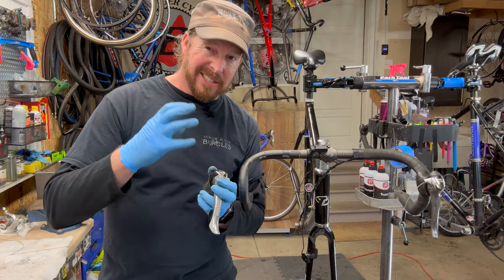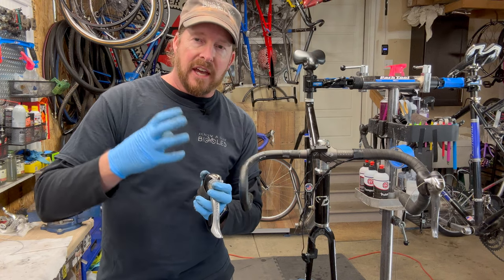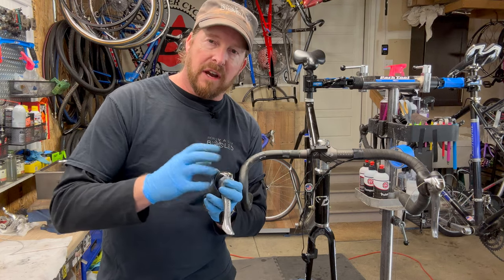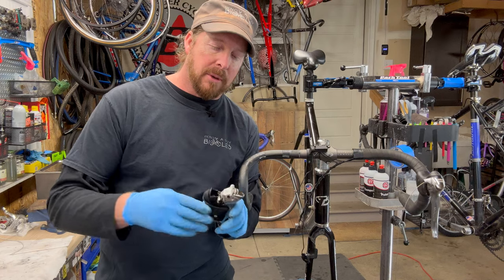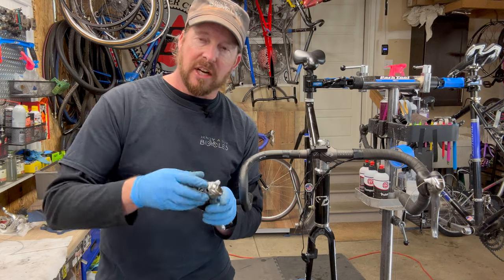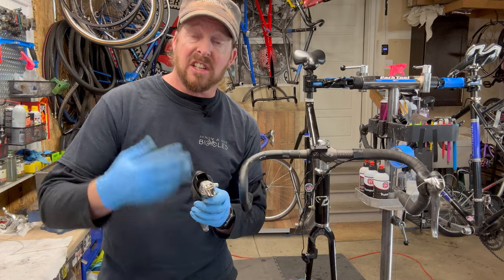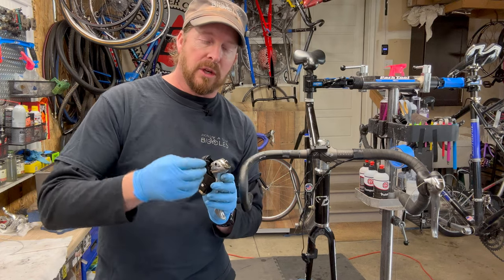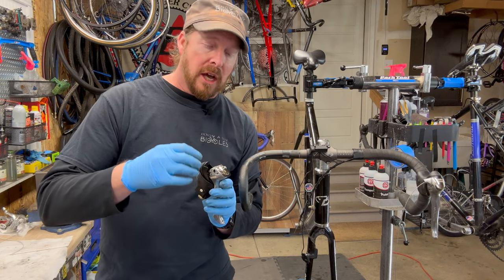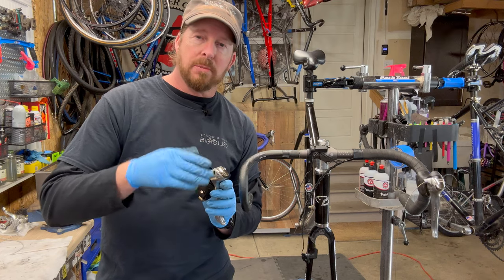But the ultrasonic cleaner has a heating element, so it's like 50 degrees Celsius. That really helps break things up, and with the ultrasonic vibration, it cleans that out. When I put them in there, I expose them open like this, so they get as much in there. And I flush it out with hot water, and that usually gets a lot of that stuff out of there. And then I replenish it with a new lube once it's dried out, the TriFlow Superior Lube, which is a lighter lube that's not going to build up, and you get that crisp shifting